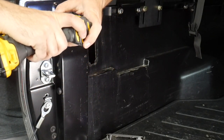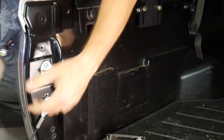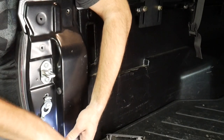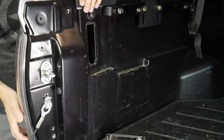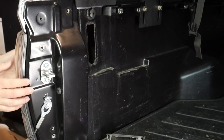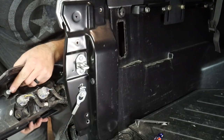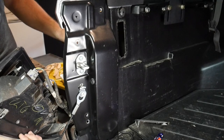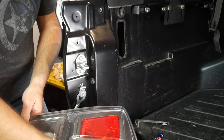So don't get too frustrated — they are a little stiff in there. A wrench and a mallet should work as well. All right, all five are out. Now you would think that the taillight would just wiggle right out, but there are actually two clips holding it in on top of those five bolts. So wiggle it a little bit and pop it straight out. You'll see there's a clip right here and another metal clip at the bottom — they go into these two holes here. That is just one extra safety feature.